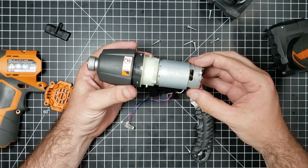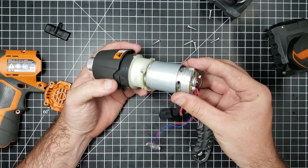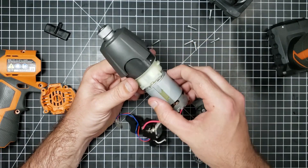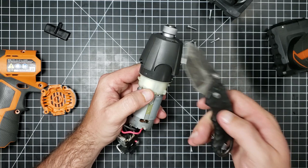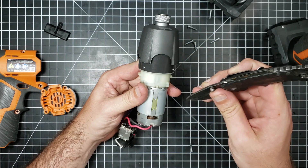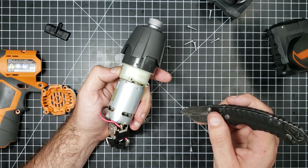The electric motor here has pretty typical construction you're going to see in any electric motor — sheet metal housing, cooling fan, plastic injection molded ends. This actually seems like plastic, but it's not. This is the business end of this drill, so it needs metal near the business end. There's a little bit of plastic right there that looks like just a coupler between the motor and the hammering mechanism.